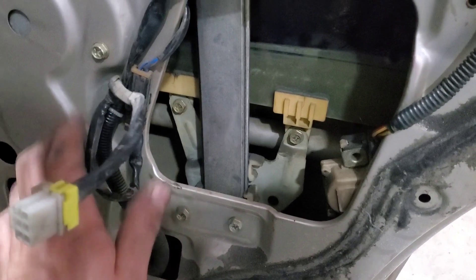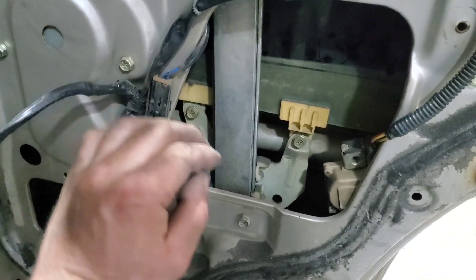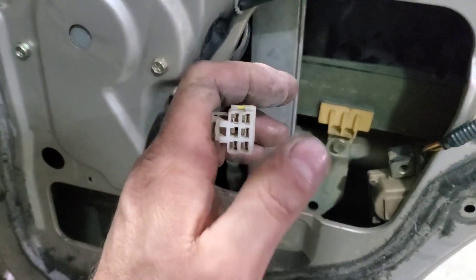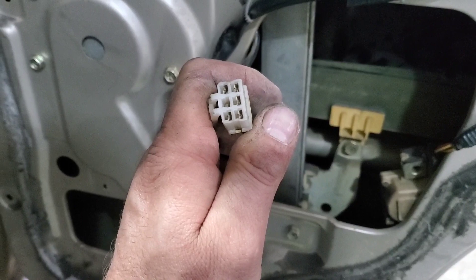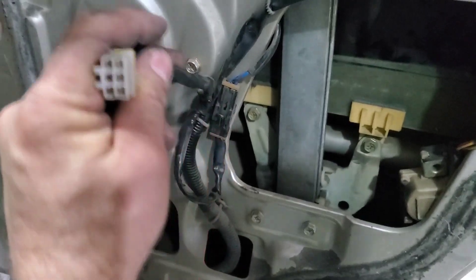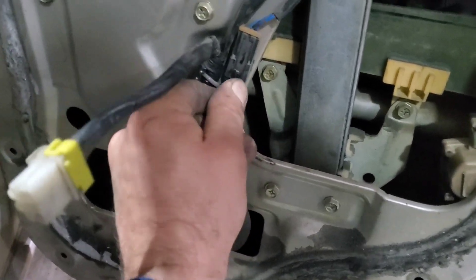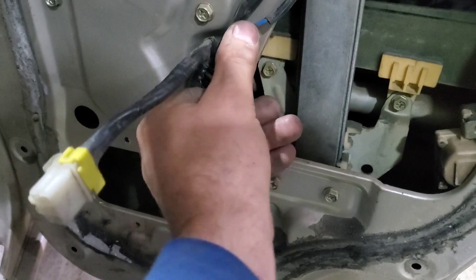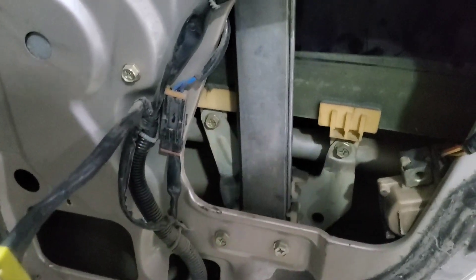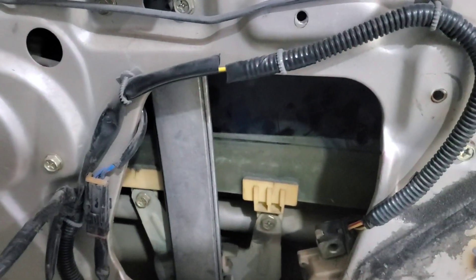I am not on my A-game — one reason I'm not working on the wiring harness right now is I've gotten sick. I was probing these pins and I realized I left the main plug unplugged — it will not work if that's unplugged because that's where you get power to the motor. Once I plugged that up it rolled right down. So: 10 millimeter, bam bam, and this window will pull right out.